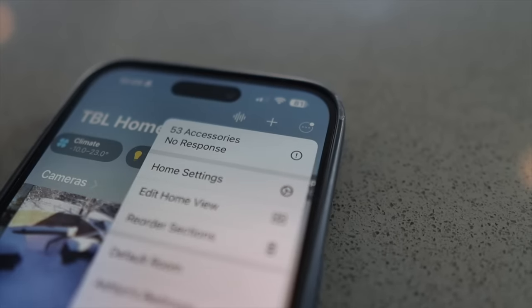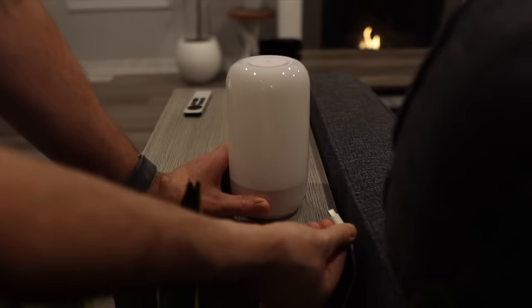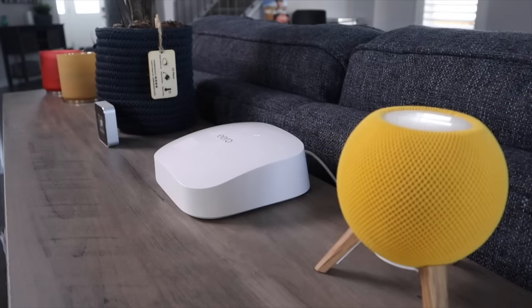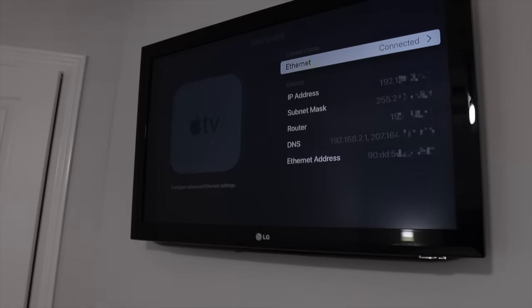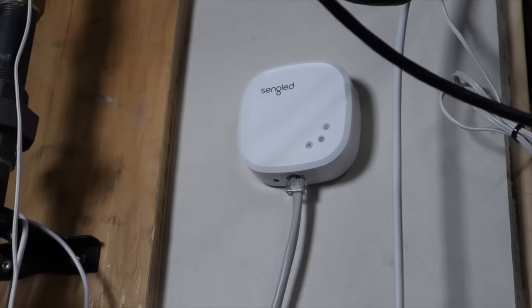Similarly, if you have devices that are non-responsive, it's time to fix it. With so many accessories in my smart home, I'm constantly doing this — there's always something not behaving properly. If it's a one-off issue or just started, there are some easy steps to try. Reboot the device: unplug it, wait about 10 seconds, and plug it back in. It could also mean removing a battery and reinserting it, or flipping a breaker. Sometimes rebooting your WiFi can help as well — unplug your router, wait a couple of minutes, and plug it back in. For Thread devices, you can restart your HomePod and Apple TVs. Some also find that when your primary home hub is hardwired — perhaps an Apple TV connected to ethernet — that can help with the reliability of your smart home. For bridge technologies, rebooting the manufacturer's bridge can sometimes solve the issue.